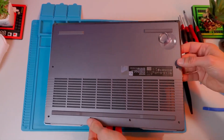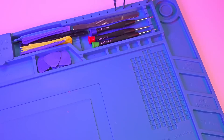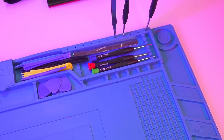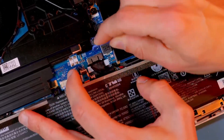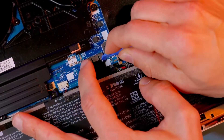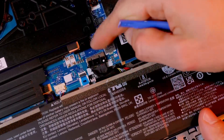If you need similar tools, they were included with the blue mat — everything cost a dozen or so Zlotis, so links are in the description. Before you touch anything, disconnect the battery connector, either with your fingernail or a plastic tool. Be careful and take your time. Remember not to pull on the cables — the connector has special spots on its sides for prying it up. Use them.